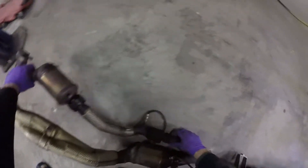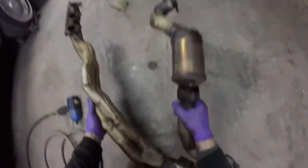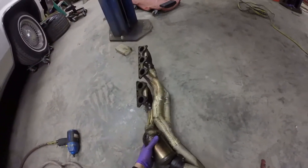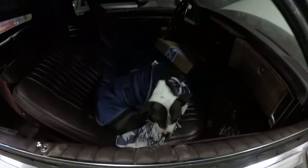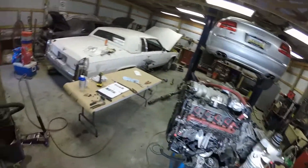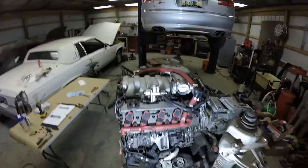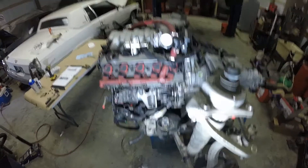That's the big boy. Here's the source of the exhaust leak - there's nothing left of that pipe right there. It was just blowing out. Got the left bank two exhaust manifold off, or header - whatever you want to call it. It's kind of a mix of a header and manifold because cylinders 9 and 10 dump right into each other. It's all designed for quick catalyst light-off.